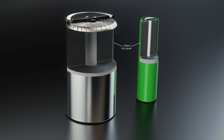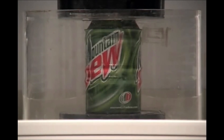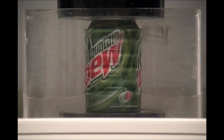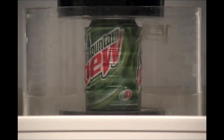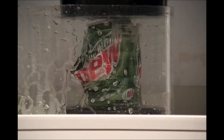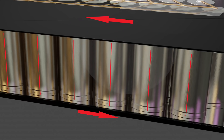Battery cells have extremely thin walls, so how do they provide so much structure? Thin-walled metal cylinders that are filled with solids or liquids can carry absolutely enormous loads. For example, a full unopened soda can has a compressive strength of 653 kg. I've linked the video in the description. This means one unopened can of soda under each wheel of a Tesla Model 3 could support the weight of the vehicle. The structural battery pack could have up to 960 cells and they'll be bonded to the face sheets, which will distribute the load across the cells as the vehicle flexes during turns.